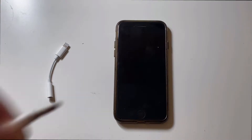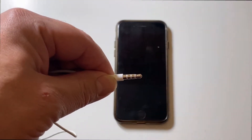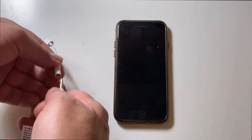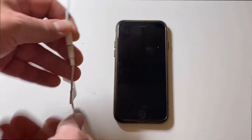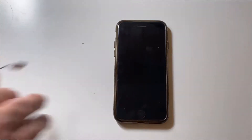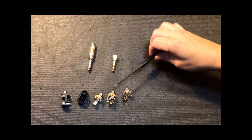If you want to use a newer iPhone or iPad, you will need the lightning port to 1/8 inch headphone adapter. However, newer headphones for the iPhone are tip, ring, ring, sleeve to allow connectivity for the microphone. We need only tip, ring, sleeve for this application, so you'll need one of these adapters as well. See my video on input and output jacks for more info on this topic.